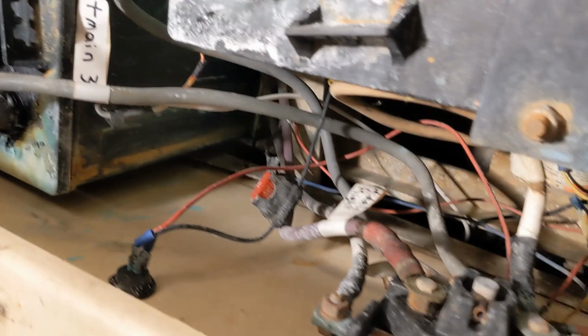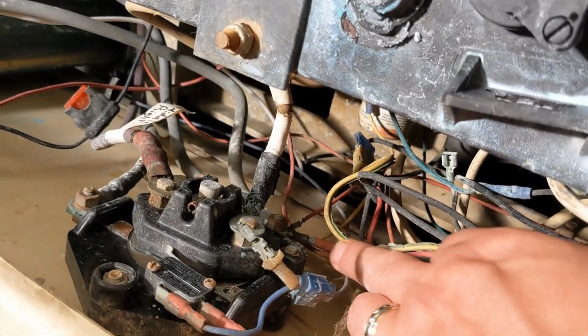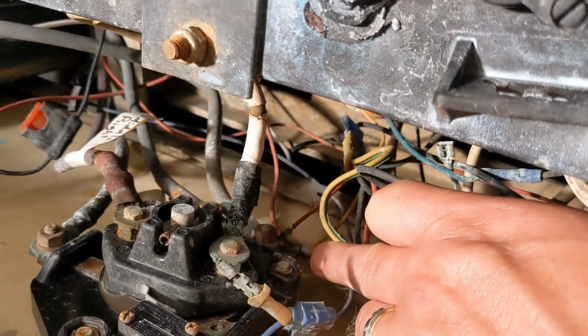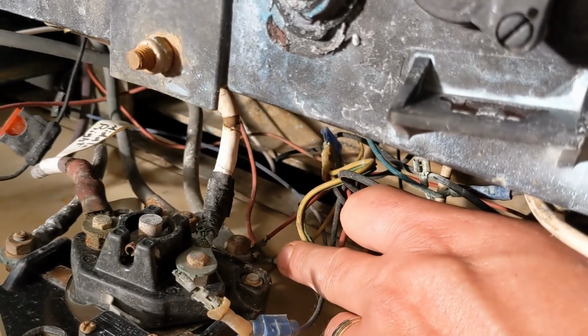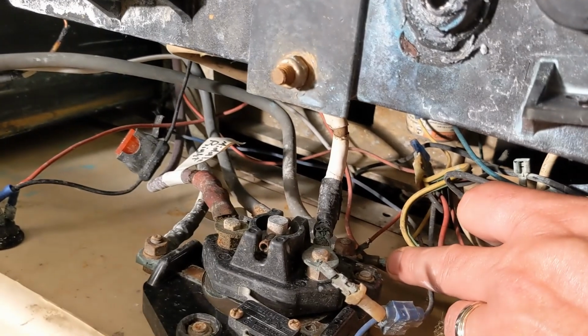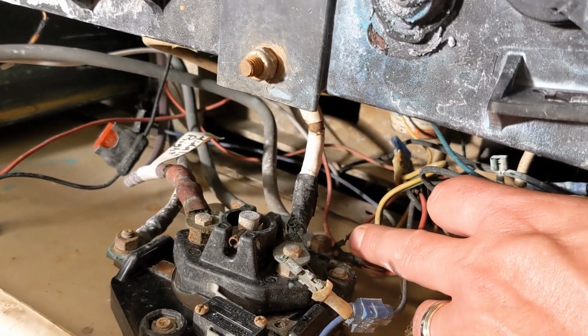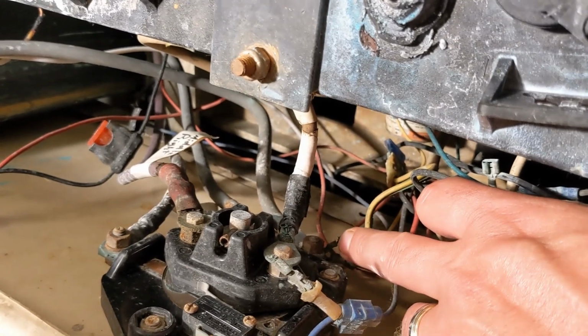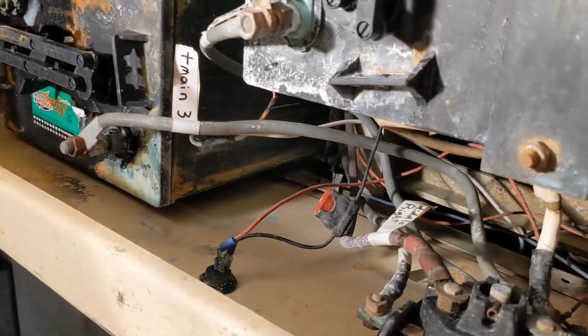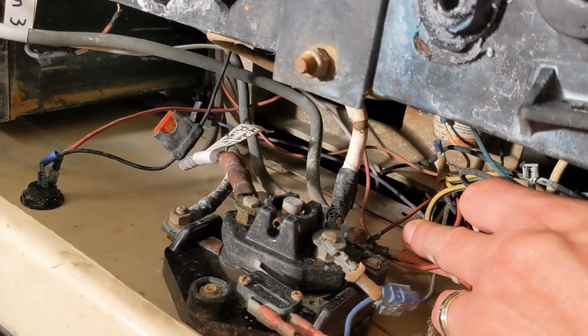Well, it doesn't on this cart. If I follow it, it's right here. All they did was they doubled up on the lug down below where our positive comes in. So rather than run it all the way, they decided to use this as its connection point. Not the end of the world, it ran fine. But if you look on your schematic and there should be 2 wires there, and there isn't, this could be one of the reasons.